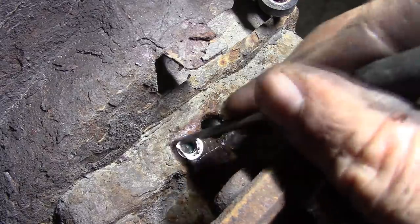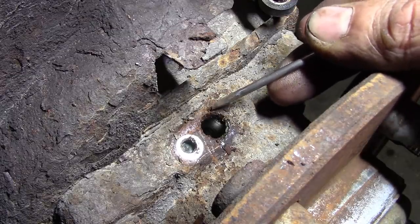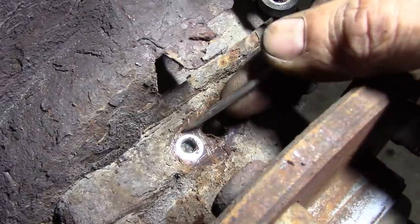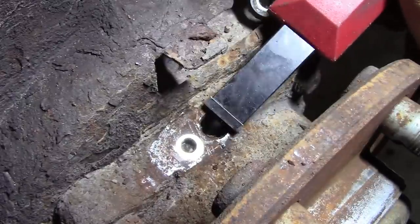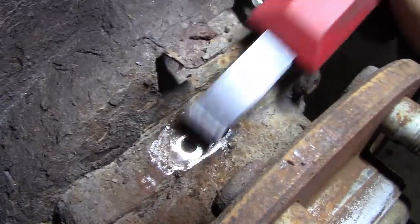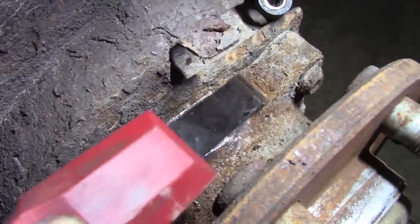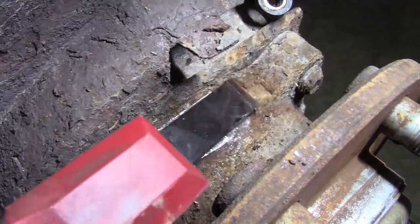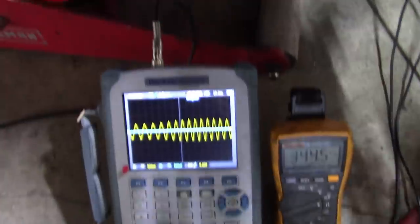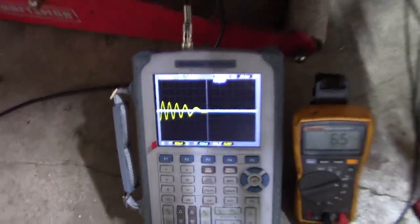No inspections here, so most people just disregard the ABS light, and if they have problems they yank the fuse out — see it all the time. This is a carbide scraper by the way — it'll cut right through that rust. Alright, I'm pretty happy with that, and the results look pretty good: all over 300 millivolts, much more amplitude on the signal.